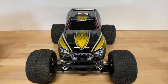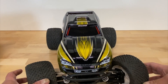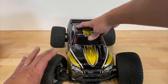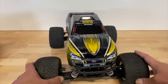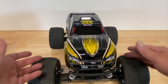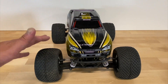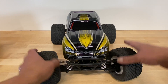Number three is to make sure the tires don't rub the body. Turn the tires full left and full right, and compress the suspension — you may actually see the tires rubbing the body. Not only can this happen at full compression, but when you're going really fast the tires balloon a little due to centrifugal force and can contact the body even at full lock under power. You'll hear a nasty scraping noise, especially in the air on full power with the wheels turned. So check through the suspension travel to make sure the tires don't rub the body, especially at full lock.